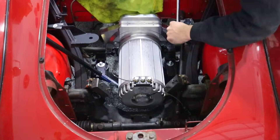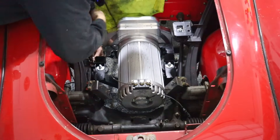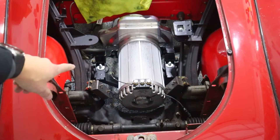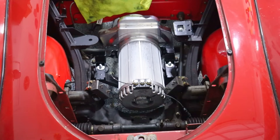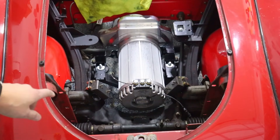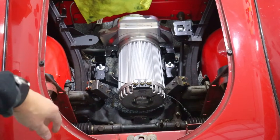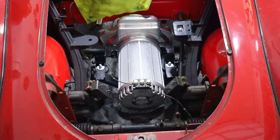It was a little bit of a chore, but we got it back mounted. We had to undo all the motor mounts, create a little bit of clearance, put a layer of paint to protect from the elements, and re-bolt everything. To begin with, there were a lot of loose bolts, so we're certain now that everything holding the motor is good and secured to the frame.